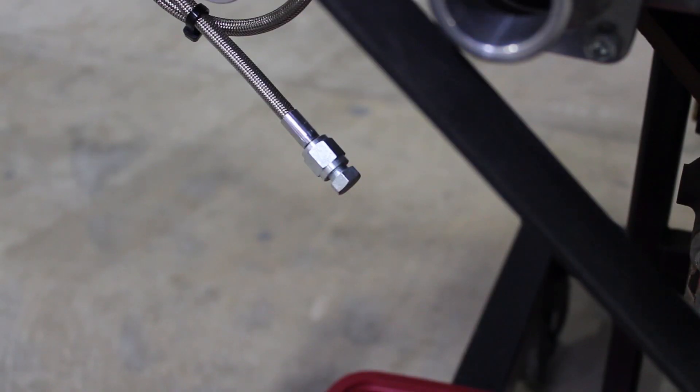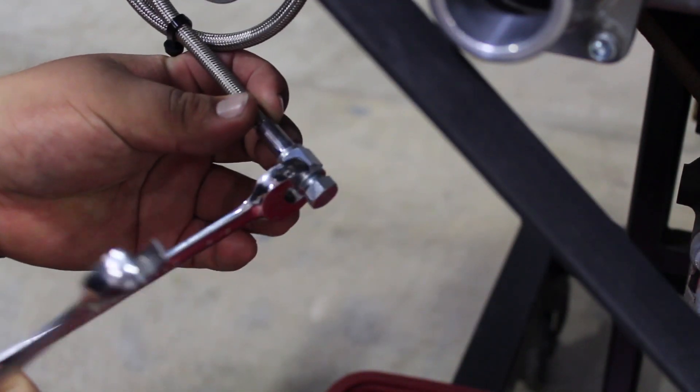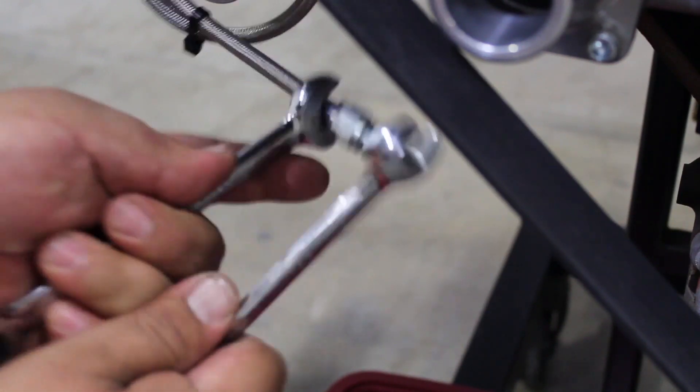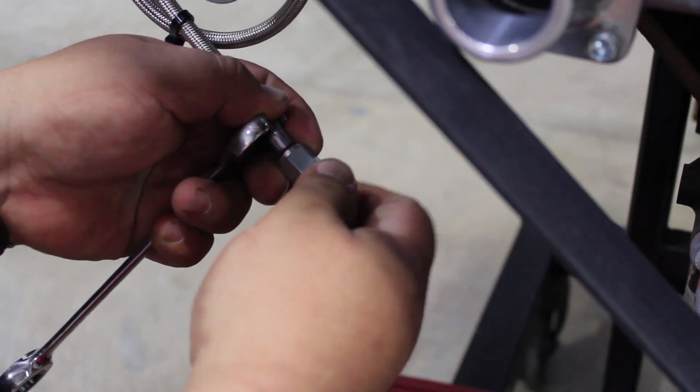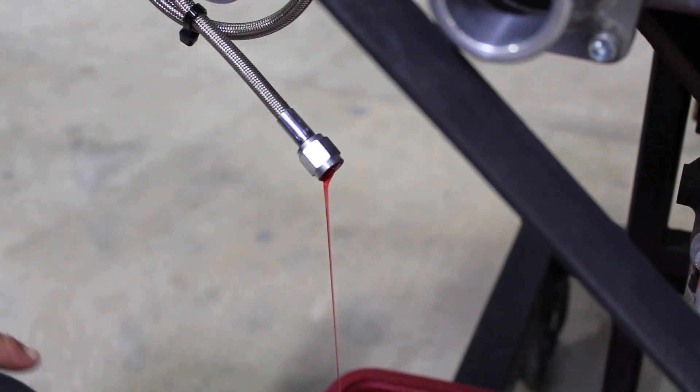For this part, you're going to need a 9/16 wrench and a half-inch wrench. What you're going to want to do is get the 9/16 on the hose part of the fitting and then use your half-inch wrench to take off the plug. These usually aren't super tight so just give it a quick little tug and it should come off. Remove this plug and let it drain into whatever oil pan you use, making sure you get all the oil out. Wait a couple of minutes to make sure it's fully drained and you don't have any excess sitting inside the Supercharger.